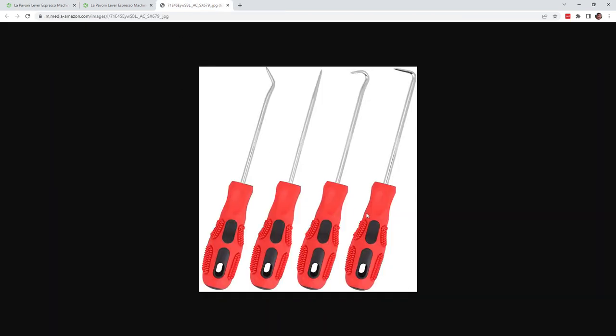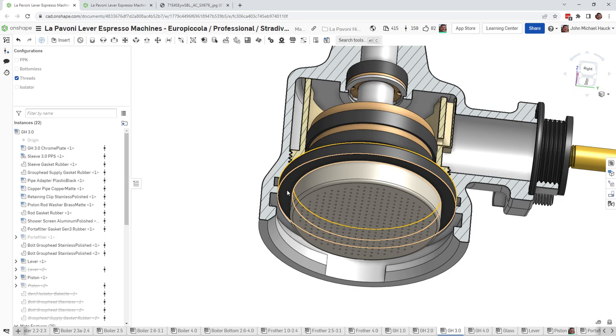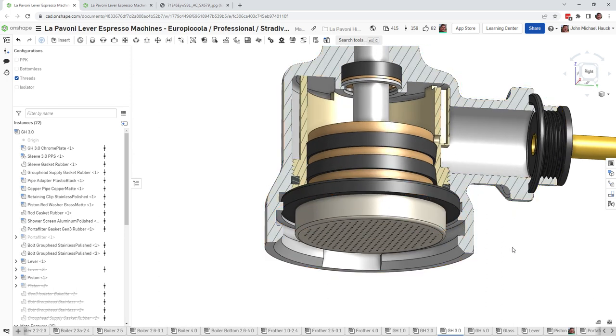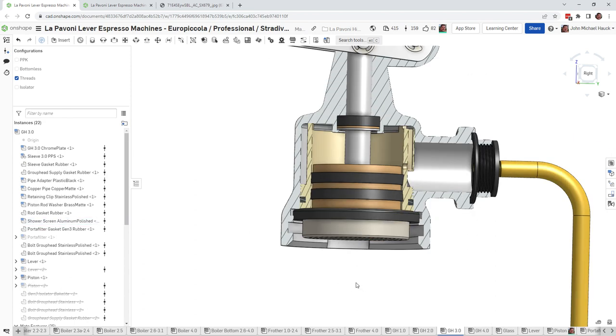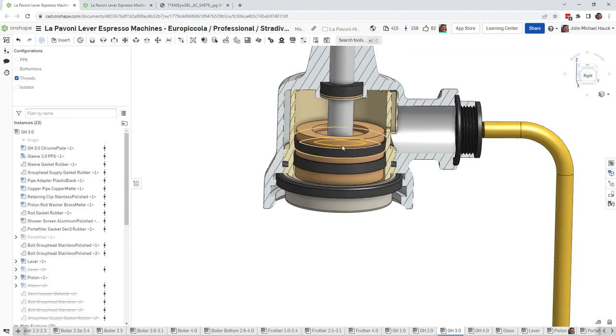I bought a little set of picks. I use this one right here, the one on the right. I literally stab this O-ring, this gasket, right in the center and pull it out, maybe stab it on this side, and then you pull it out, and then the shower screen will drop out, and you'll notice it's a little dirty, so you want to clean that. Then this whole assembly will drop out,